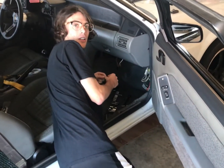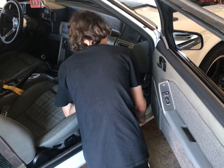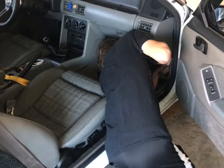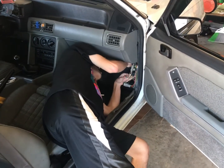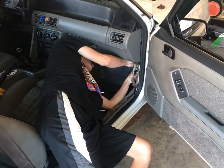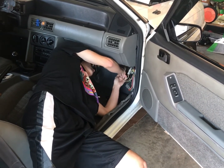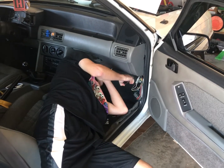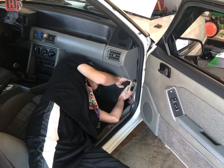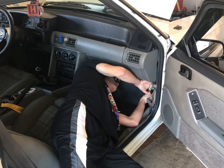Those capacitors were around eight bucks — I bought them on eBay, less than 20 bucks with shipping. They were advertised as the most current Japanese-made capacitors available, and I think the original ones in that Motorola ECU made for Ford were also Japanese-sourced electrolytic capacitors. I'm by no means an electronics whiz, but replacing those three capacitors, it went from running like poop to running like new again.